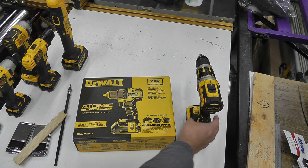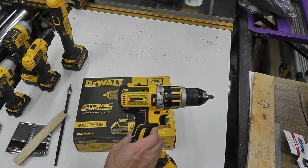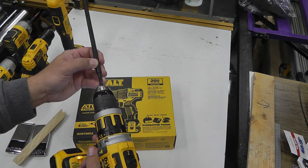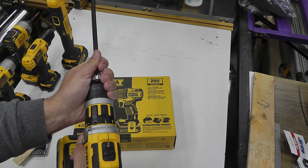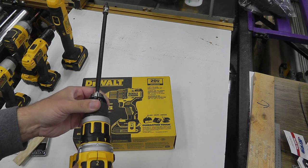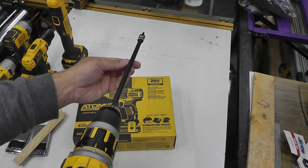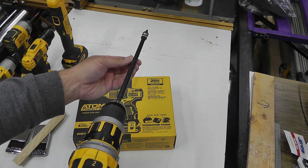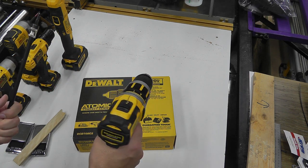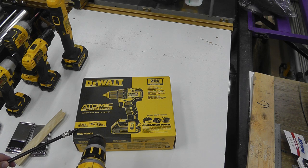I've had a bit of a love-hate relationship with my DeWalt DCD 795. It's been an okay drill but the chuck has given me nothing but a hissy fit — I've had some major wobble issues. It's really hard to find the right spot in it, and if I'm not careful it'll give me a wobble and I have to reseat the drill bit a number of times. I've taken it apart, cleaned it, fixed up the teeth, but it still wobbles. It's also heavy, and right here the box says 25% more compact with 13% more power.